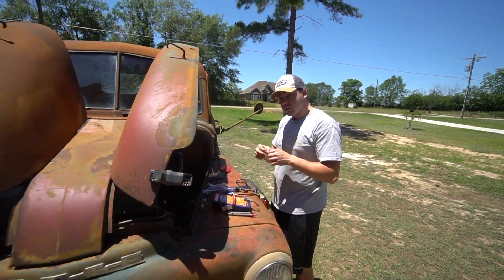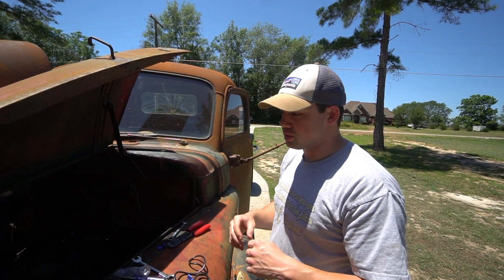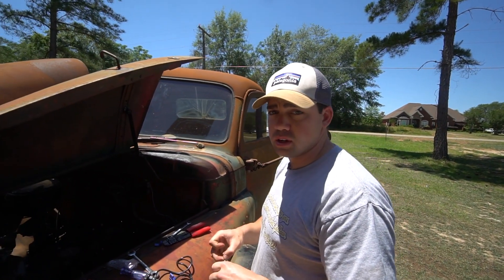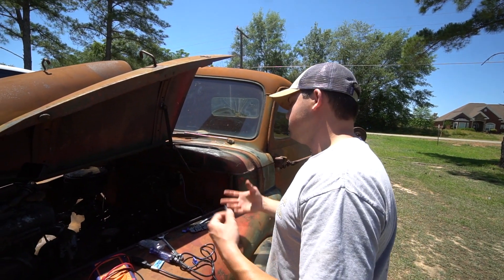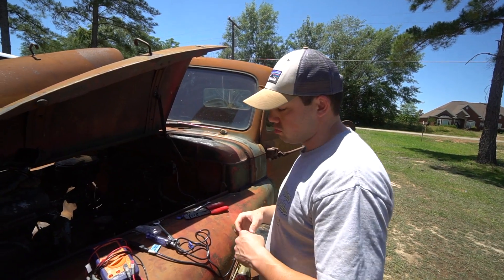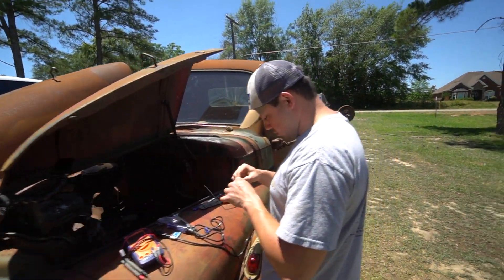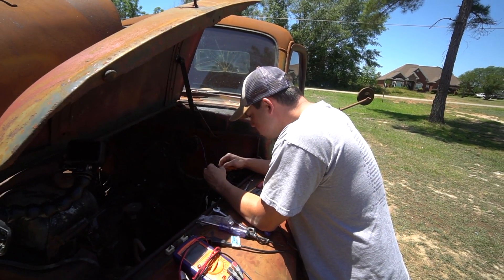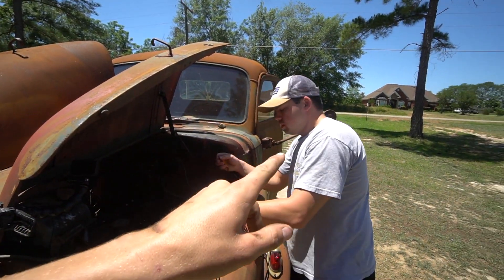We should be installing this shortly once I get an email back. Caleb is working on his 1951 wiring mess — this old farm truck. You know how when you're out on the farm they MacGyver everything, and we're trying to un-MacGyver it because we have a big spark problem. We replaced the plugs, wires, condenser, ignition coil; we're waiting on the points, rotor, distributor cap, new battery, new grounds, new power wires. If you guys want to see the build videos on this old 1951 peanut truck — it's a dually, pretty sick, four-speed manual — go over to Paradox's channel. He's got three videos up and he's going to be posting one tonight of hopefully this truck starting.